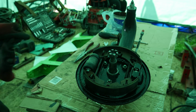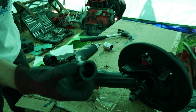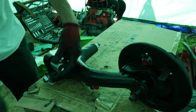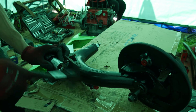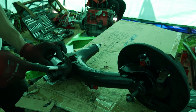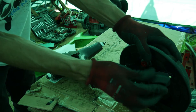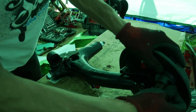Now I'll show you fitting the knuckle cup — it's like a ball joint cup for the radius arm. The best way I've found is to start it off by hand as far as it'll go, get a socket that matches the size, and it will guide its own way in. That's it — perfect, no damage or anything. While I'm here I'll fit this rubber grommet on the back to cover up the handbrake lever gap.